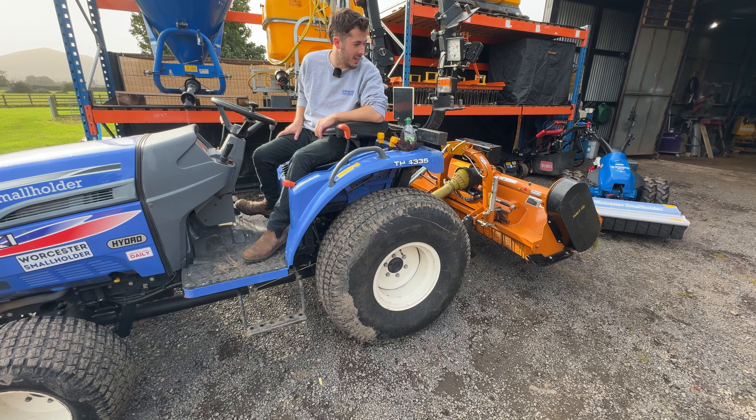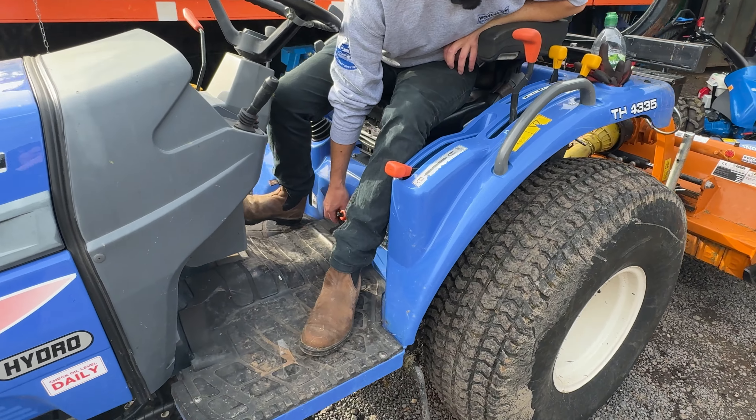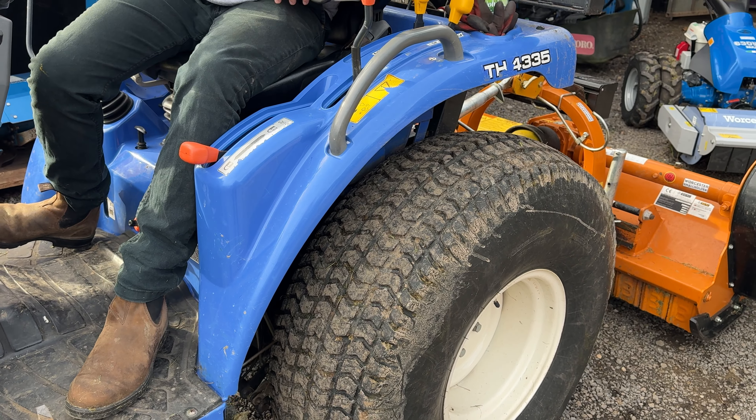So I'm going to reduce it. I'm going to turn the knob in maybe a turn and a half, lift the mower up and see if that's a bit better. As you can see it's dropping really really slowly, so I've tightened it up too much.